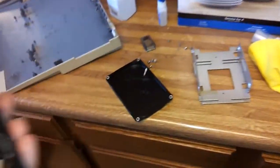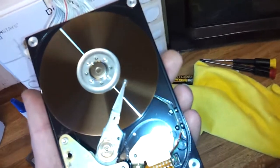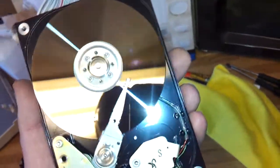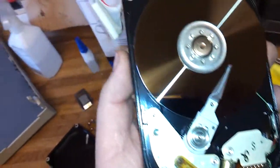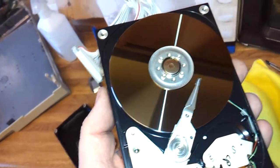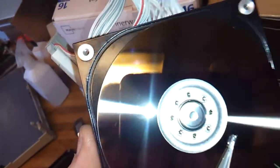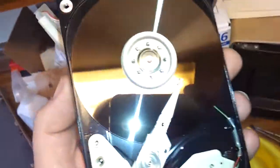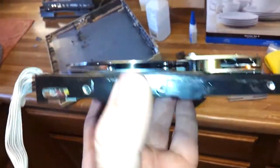I got that clean. Now I've got to move on to the lid and clean it. I'm going to lay a new bead of silicone down in there, put the lid on and let it dry. I've got to be very, very light on the silicone, just a tiny bit — because if you put too much in there and you go to clamp the lid on, it's going to ooze out and get all over the platter and everything. So you have to finesse it — just put a tiny itty bitty bead in that groove, unless you have O-ring material. If you have O-ring material, you can just lay out a new O-ring, but until then I can't do that.